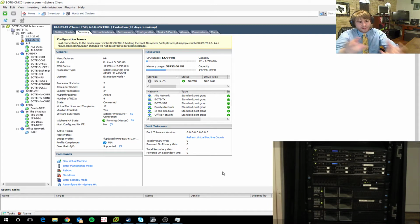And it gets its internet from AT&T. It goes from their firewall into my host, and then from there, the host only allows pfSense to interact with that vSwitch. And pfSense then uses another NIC and passes it over and allows all the systems to connect together. Passes it over to the switch, the Cisco switch.